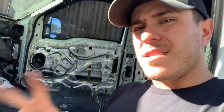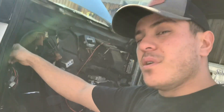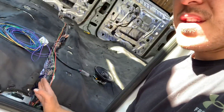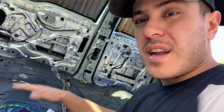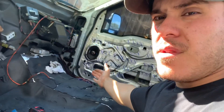The second kit is for when you're not pulling your dash — you've got stock interior and just want full power mirrors. You'll come through the door jamb; it's a pain to get your hand up in there, but it's possible without pulling the dash. You can get your wires through the cab and feed them down the door jamb. There's a wire tunnel under the seats, so you can run your additional wires across it. You'll take your seats out, pull your carpet back, run your wires, and feed them through that door jamb. So: either behind the dash or under the seats.